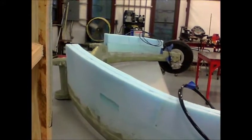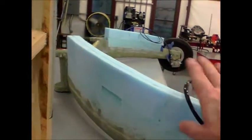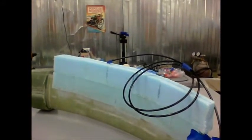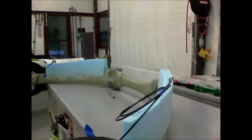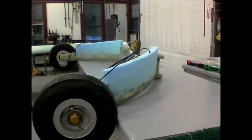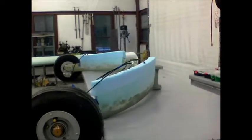Wayne Hicks says you need a four-to-one ratio of thickness to the length of your airfoil, and I did not have that on my stock wheel landing gear. So easy enough — I got the gear off and went ahead and did that. Surprisingly, this was pretty easy to do; I did it in about three hours. Taking a break from the strakes to build the main strut fairings was kind of fun.